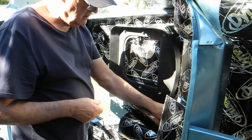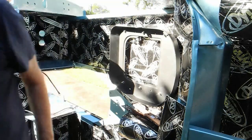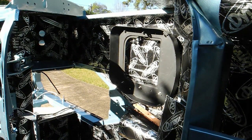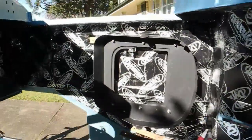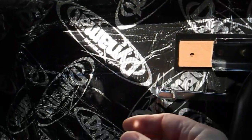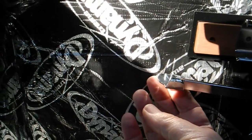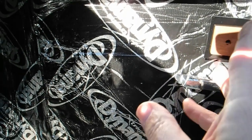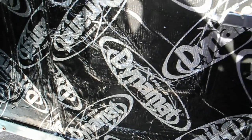No, something's wrong. If you look at the blade of the adjuster, I'll just show you. I think I've just put that in wrong. Can you see that there? That blade is facing down. Definitely a no-no. So it means that I've got these slides on the wrong way around. That's got to face up. Okay, so small error. I need to fix that.